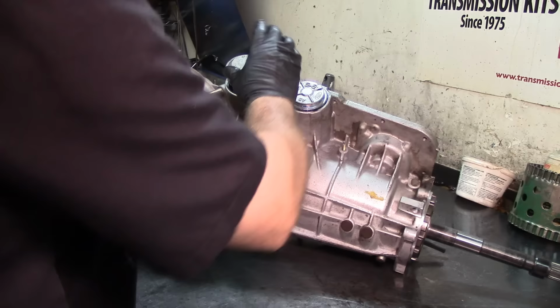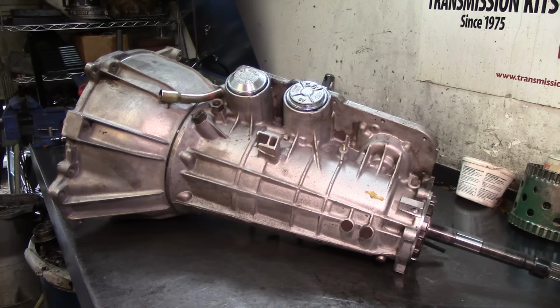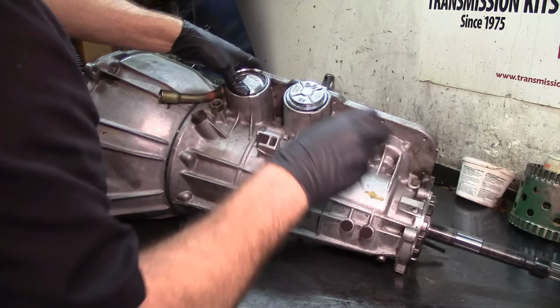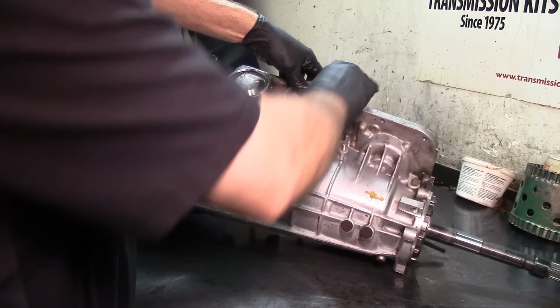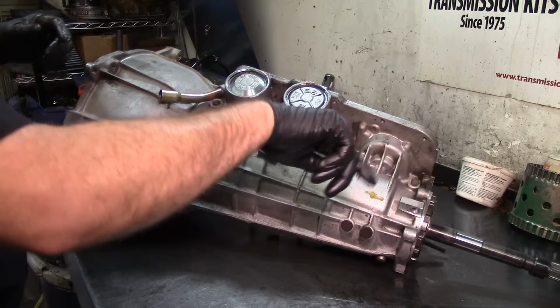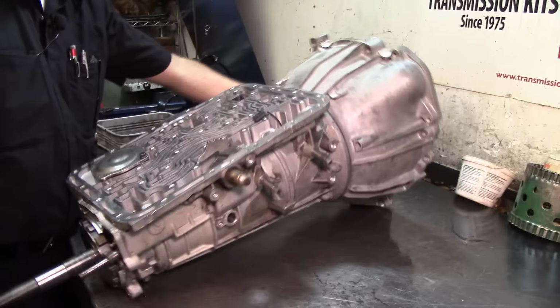Let me get the snap rings. So everything is nice and lubricated. Now we're gonna go ahead and just push these things in and install the snap ring on it. Push the intermediate servo in and install the snap ring. Now I'm gonna flip this transmission over so you guys can see this way,